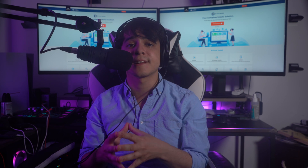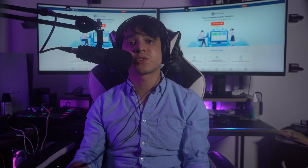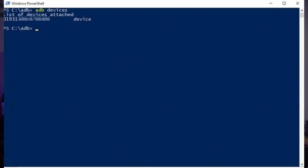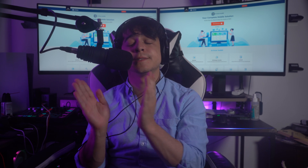Next, download Android Debug Bridge, or ADB, software on your computer. Start the setup and answer Yes to all questions, then tap Enter. Upon completion, a warning message will appear — click Install to proceed. Find the directory listed on screen, then click Open Windows PowerShell. In the new window, type 'adb devices' and hit Enter — this will display your device's IMEI number. Then type 'adb reboot' and hit Enter to restart your phone. Close the window and unplug your phone — you should be good to go.